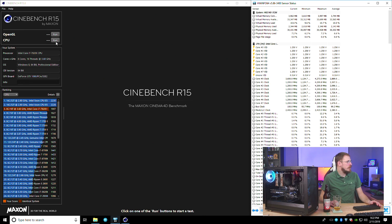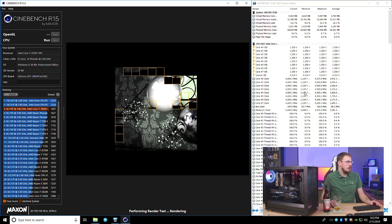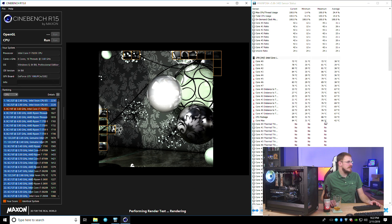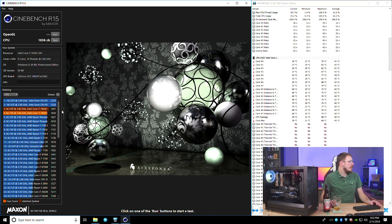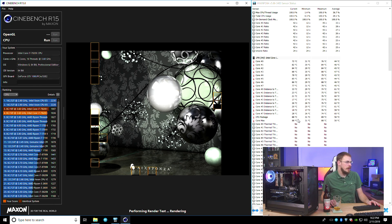Let's hit run. You can see us hitting 4.2 gigahertz there on an all-core turbo — not quite what I was expecting. But let's look at temps: actually, that's not too bad. Hottest core is at 86°C — there's 88, and now we're climbing. And 1836, which is not my best score, but it's getting up there at least with this version of Cinebench. We're actually sitting there and leveling off right around 87-88 degrees, so we've got a little bit more headroom to go.